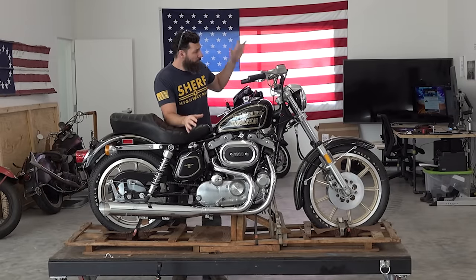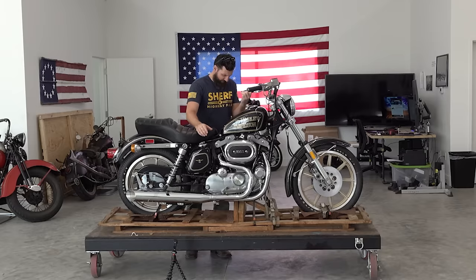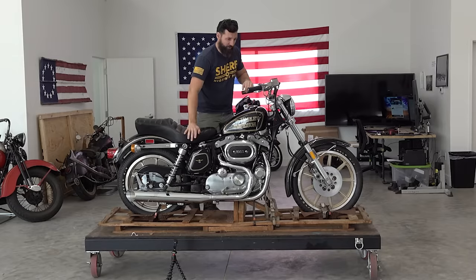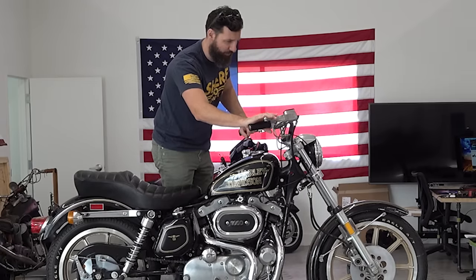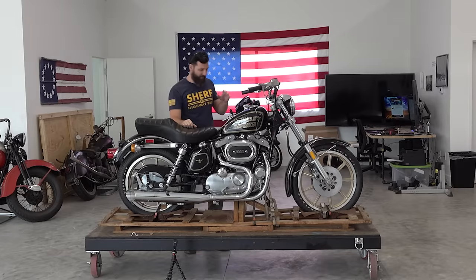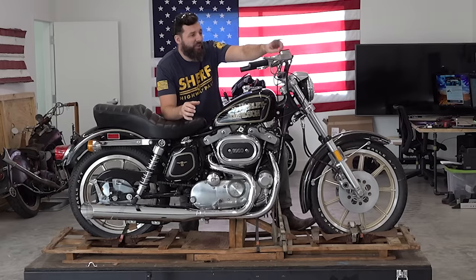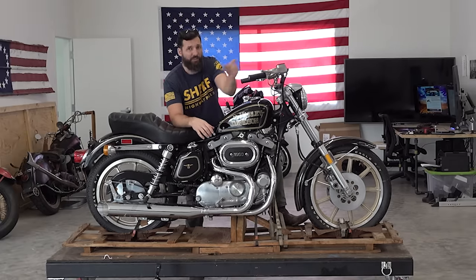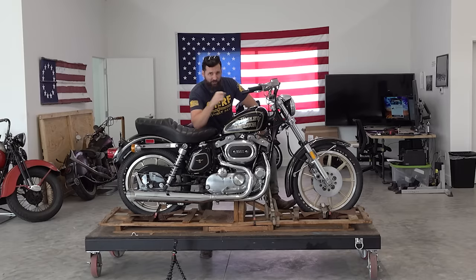Next observation: good news, this is a cable clutch, not a hydraulic clutch. That feels like it works. Observation number two, this brake is completely floppy. I've never unboxed anything - I've never ridden a Harley from this era. I'm hoping that maybe they ship these motorcycles out with no brake fluid, because brake fluid does not last 45 years just sitting there doing nothing. It turns into dust.